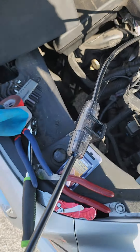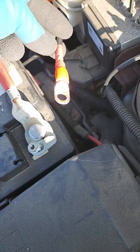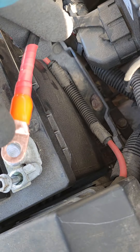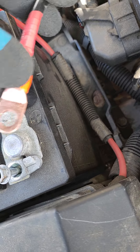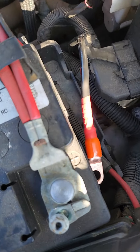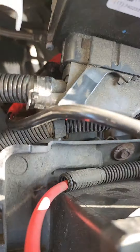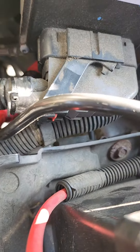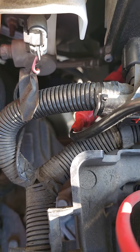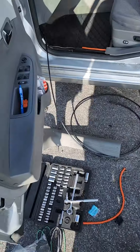I got my power wire into the engine bay. I changed my little black heat shrink for an orange one because it makes more sense — it's going on the positive terminal. I'll get my lighter out later and shrink it down on there. I put some tape on the back end and it's pretty solid. We've got the fuse down here protected nicely and the wire is going into the firewall, so it's into the cabin now.